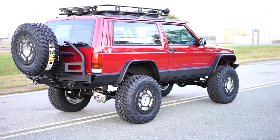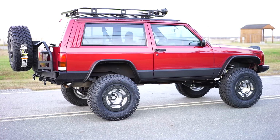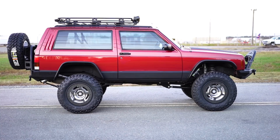Vehicle does have a long arm suspension system, 4.5 through 5.5 inch. It's optional how you want to adjust it, obviously. You do have rear adjustable shackles as well. We do have it on the higher shackle setting in the back to give it a little bit of room in the back. Leaf springs will settle over time. So the back we have sitting up about 1/2 inch more than the front.